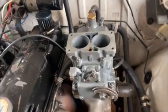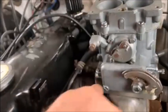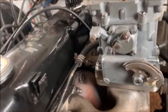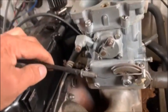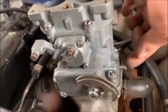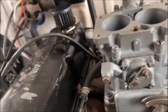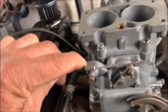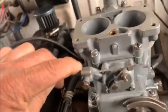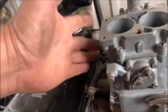There's a lot of debate on which way around to put the carby. I've had them both ways and I prefer this way around. My accelerator links are all in front and my accelerator cable reaches easily. The idle mixture screw and idle speed screw are right there where you can get in with a short screwdriver — if it's on the other side you're going to struggle to adjust. Also your choke is right here, so if you want to use it, the choke cable goes in straight. If you put the carby the other way around you won't get your choke in and it's awkward to make a throttle cable work.